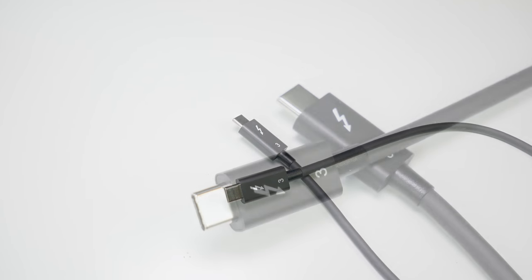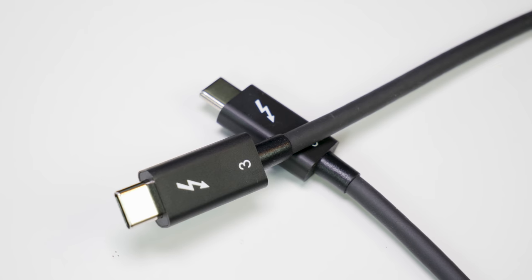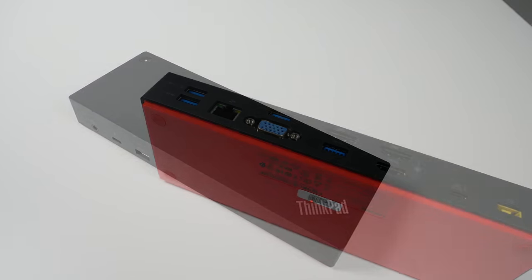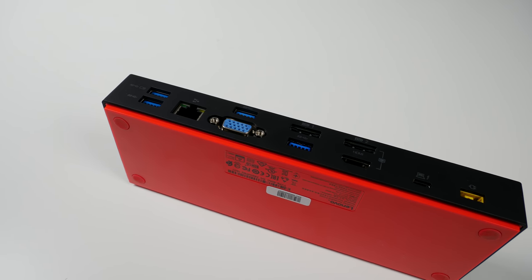One more reason was that back when I got the T460P, I got it because it had an additional NVIDIA GPU — should be a 940M or something like that. It's a quite low-end NVIDIA GPU, but I thought I could use it to accelerate video editing or CAD work. But I figured out that if you use a normal NVIDIA GPU for CAD — like SOLIDWORKS or CATIA — and it's not a Quadro, everything is extremely slow. I always had to use the Intel iGPU, which for some reason is so much faster in those CAD programs.